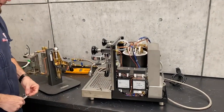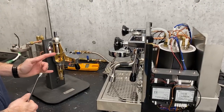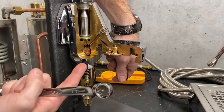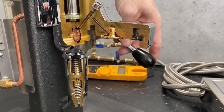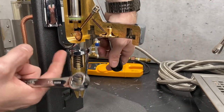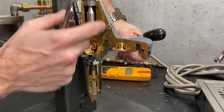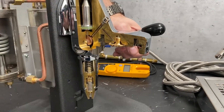I'm going to show you what I'm talking about with the pre-infusion — how that correlates with the valves in the group head and the brew switch. I love this cutaway model. So, if you'll see here, when you raise the lever, you get into a middle position; this cam is not actually opening either one of the valves. Dropped all the way down, these valves are open, and that vents the pressure in the group. Middle position, no valves are open. Top position, upper valve is open, allowing the water to run through the mushroom valve into this chamber, up through here, out there, and then into your coffee.